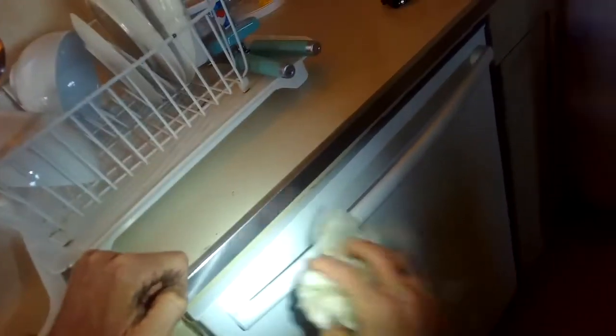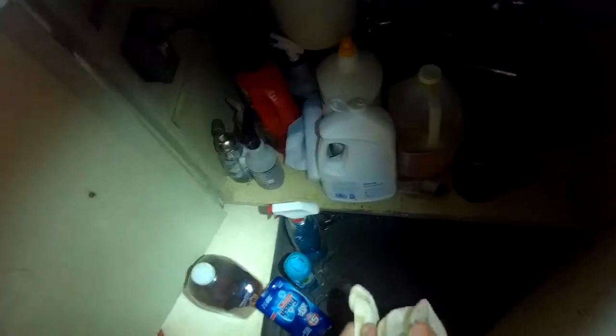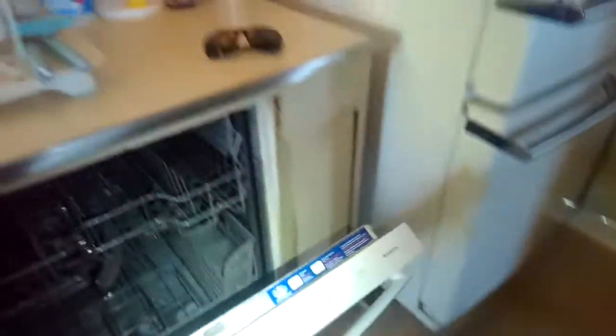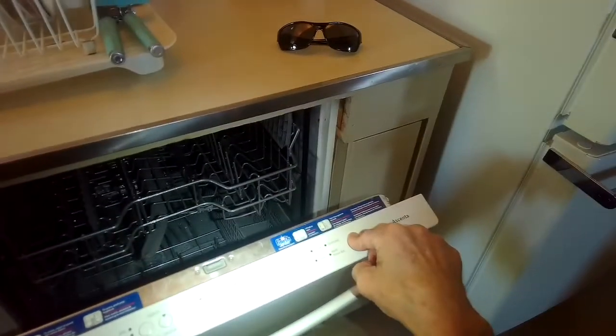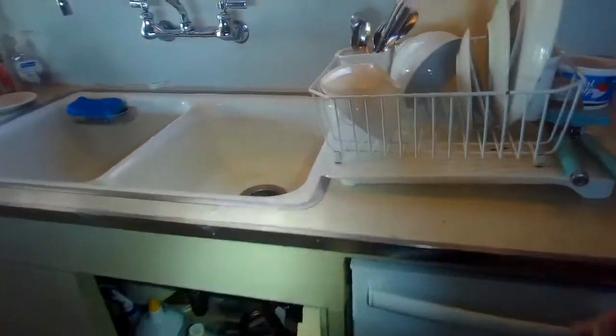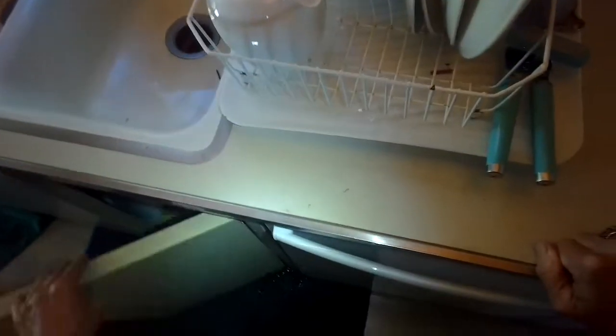I'll set the drain cycle — let's see if that's going to work. These are really good dishwashers; they have some of the best consumer ratings, they're quiet, they clean the dishes really well. We have a full contingent of water now — you can tell by looking at the filter handle, the round filter — the water is at that level, which means that's exactly where the water level should be on a healthy dishwasher. I'll press that start button for about three to four seconds; that'll activate the drain cycle and reset the computer. Close the door and you should hear it pulse about three or four times and then it should be a continuous drain.